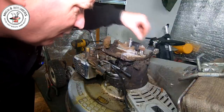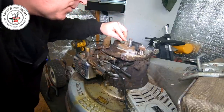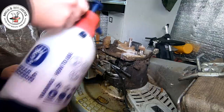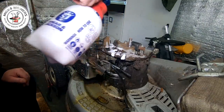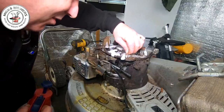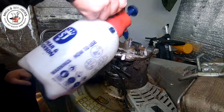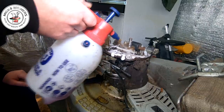Here's the coil, and there's a keyway — don't lose that or we'll be in trouble. We've got a little condenser as well, so it could be a condenser issue. I need to get this coil cleaned up and tested before I do anything, and give it a good clean. I've got some degreaser — a bit of a shake up and just clean the area up as best I can, then blow it off with the air gun. It could be a coil issue; there has been a connection here which could be a bit loose — that doesn't look brilliant actually, so I'll check that connection out.